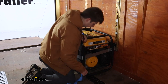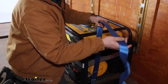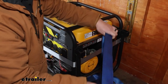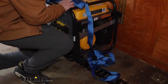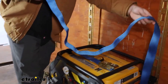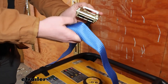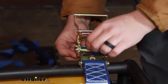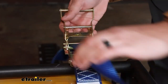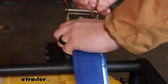For our extra strap today, you see I've got one going around the side into the E-Track that we've got on the wall. I'm going to do one on the ground, kind of feeding up over top of the generator, just to make sure it's boxed in on all sides. This is quite long for our application — really we don't need this much length, but if you do have longer cargo it'll work really well. The one thing I just want to make sure of is that I'm keeping the strap straight, because I don't want it to get twisted up too much. The free end of our strap will feed through the ratcheting mechanism just like a regular ratchet strap. We'll pull out all that slack, and if you're tying down something a bit more size-appropriate, you probably won't have to deal with all that.